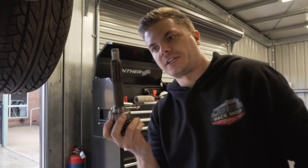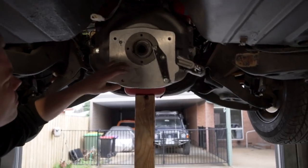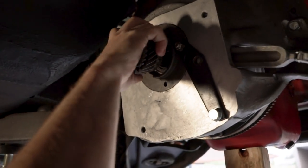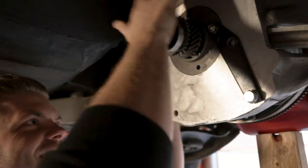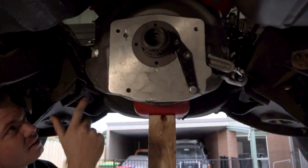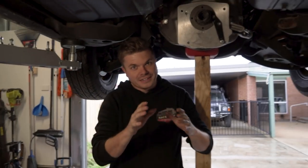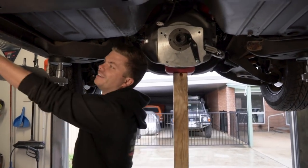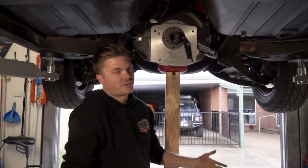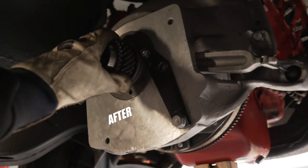Michael Vleck from Vleck Records was kind enough to lend us an input shaft, so we made up a dummy input sleeve. We're going to slip in our dummy shaft — a lot of dummies here, especially the two behind the camera. This essentially gives us a pretend gearbox in place, which allows us to play with this screw to adjust in and out and make sure we get the clutch alignment right. If anybody knows an easy way to do this, please let us know in the comments — I've tried looking all over the internet and the only information I can find is on hydraulic clutches, and this is a cable clutch.